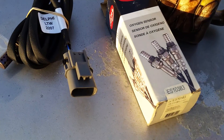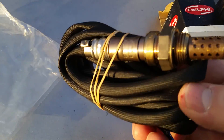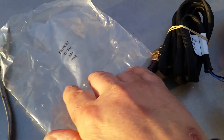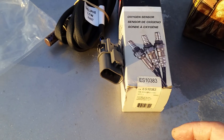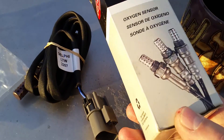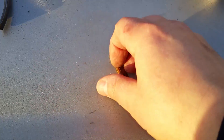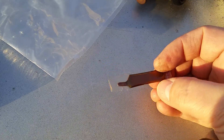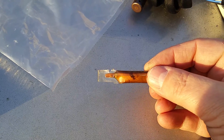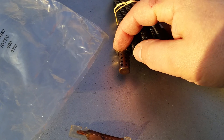This is the O2 sensor for the vehicle — it comes with a wire, a connector, the whole bit. This is brand new. It comes in a package; you buy it off eBay for about $30 — $29 and some change with free shipping. It also comes with copper thread anti-seize compound. Put that on the threads but keep it off the sensor itself, because it's not good for the sensor.